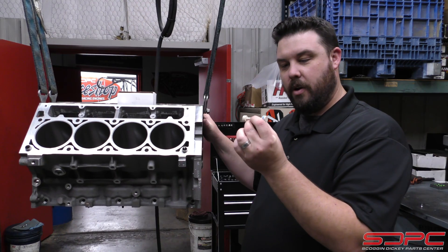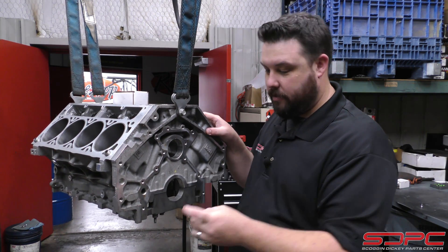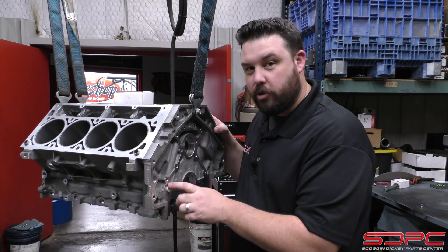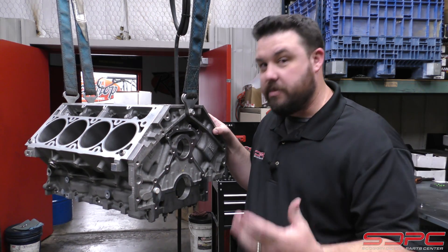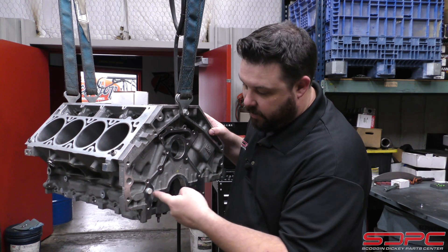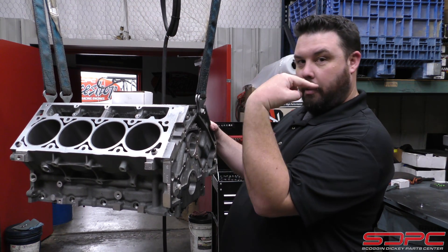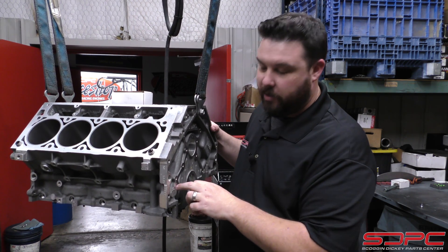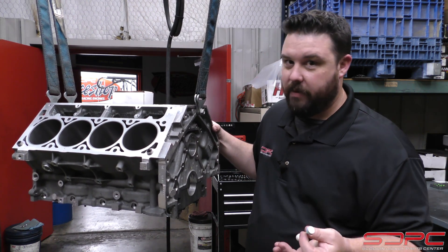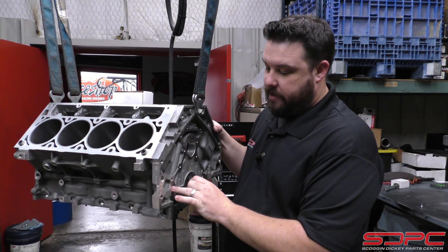Here's the biggest question: where does the O-ring go and why? Because all the oil pressure would be lost in the back, this O-ring needs to go on the rear side. And that's all this is — it just pushes in by hand. I'm not going to push this in because they can be a little tricky to get out. If you have a used block and you're trying to get this out yourself for a junkyard build, don't feel bad — you've got to use a screwdriver, a knife. Some people put a real small wood screw in there, drill it in to grab it so they have something to pull out. Another trick: if you have access to those old passages at the bottom, you can put a screwdriver in there and push it out. Be careful though — don't damage anything. That O-ring has to seal in there, or you'll have an oil pressure leak you can never fix without remachining the block. So that O-ring keeps everything sealed so we don't lose oil pressure.